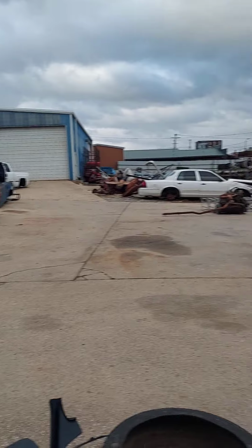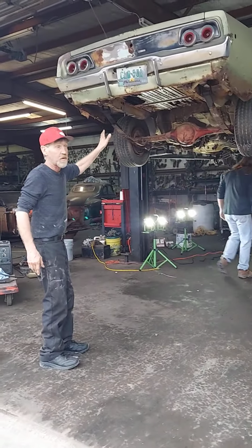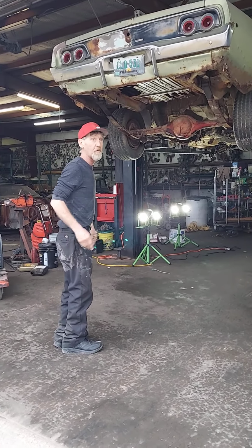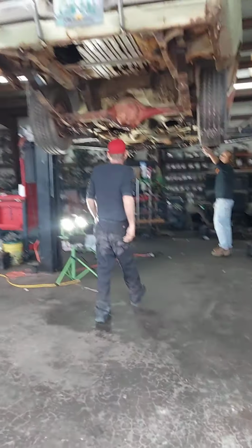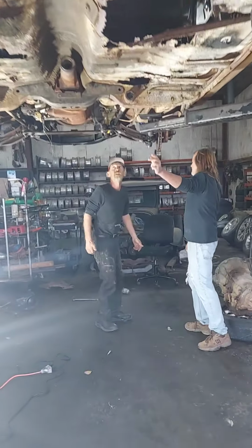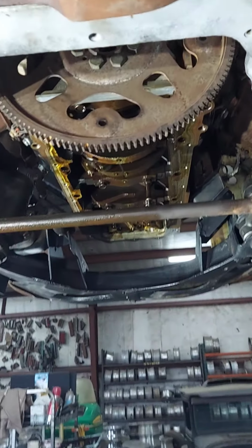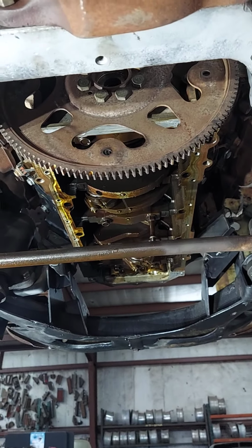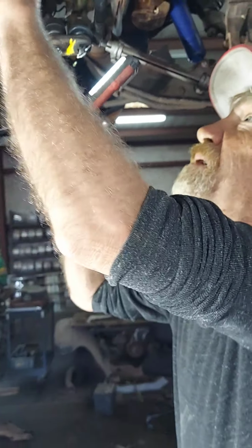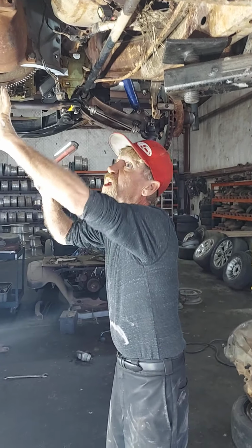Another one right there. What we're trying to do is make a mock-up car to put the 5.7 in there. If y'all will come on and look at it, I sure would like y'all to see it. Come over here. I need a red light. Let me show y'all what we got to deal with. Come right over here. When you put the 5.7 Hemi in here, you can bolt a 318 bell housing to it with the 833 4-speed. You see that it's all in mock-up stage.